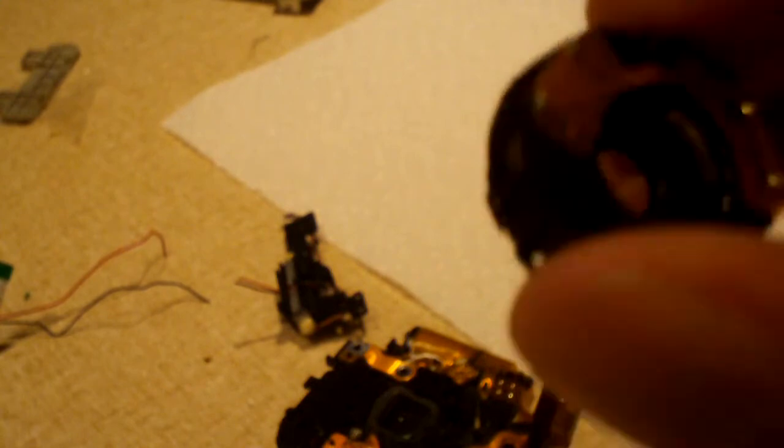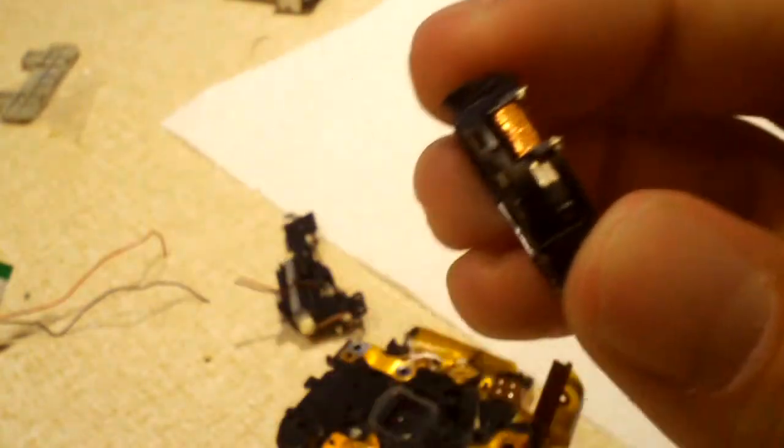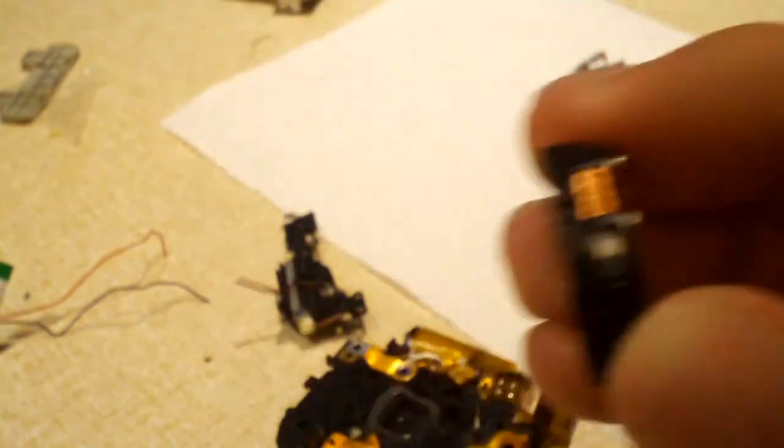You gotta think, the aperture and shutter inside the lens, every time you turn the camera on, it moves forward and back a little bit. When you zoom, it moves forward, it moves back. It moves all over the place. So after all the years of excessive use from your camera, this thing's moving back and forth, back and forth. I mean, you can't rule out the possibility that perhaps the connection going to this failed.